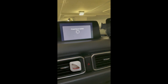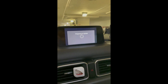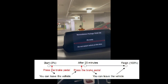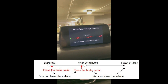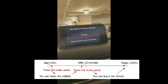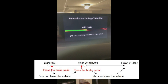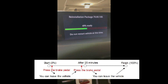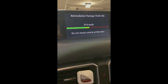Your ACC goes to sleep mode after 25 minutes. So it is very important that you press your brake pedal for your automatic car or the clutch pedal for your manual car before you begin this process. Keep a timer and press the brake or clutch again after 20 minutes. You are mainly doing this to prevent your ACC from going into sleep mode.